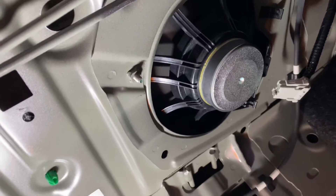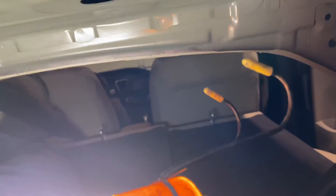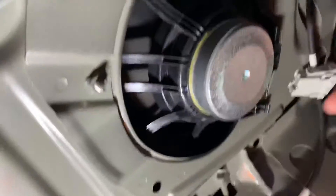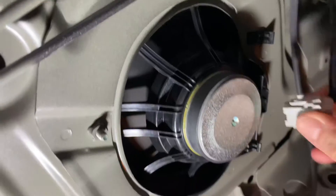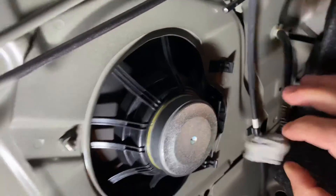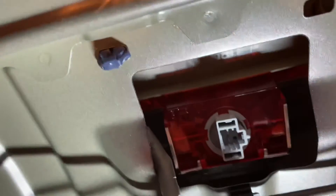Step one, fold down the two rear seats, slide in the back, disconnect the speaker on the right with the clip. Pull the clip out by holding down both of these two side tabs and pull down. Disconnect the rear light in the back window right here — little clip, hold it down, pull it out.